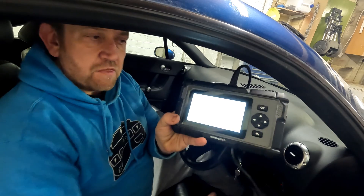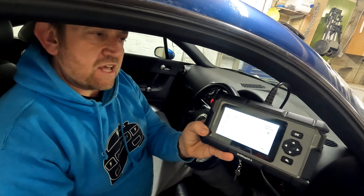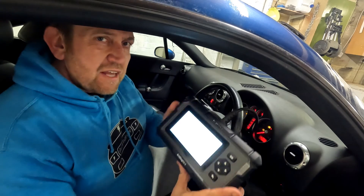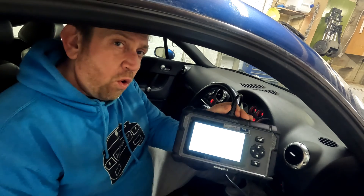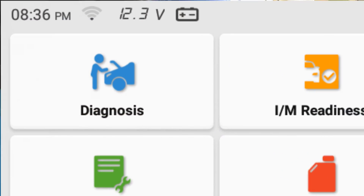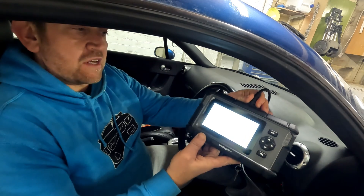It's worth pointing out the maintenance features visible on screen: ABS, brake bleeding, oil health — all accessible from this screen, making it a much better workshop tool than a simple plug-in Bluetooth reader. Clicking on the OBD2 section, it now connects to the car. It will go through all the various protocols — you'll find it says failed until it finds the mode for your car and then says connected. It's now connected and telling me the management light is on — we know that. There are two error codes listed in the ECU.